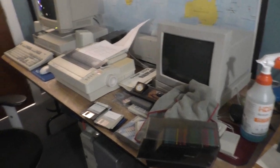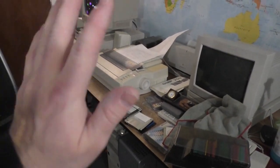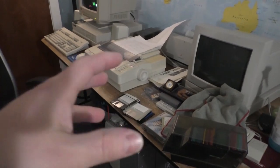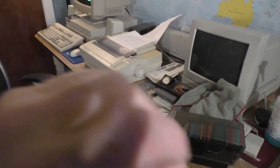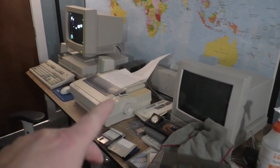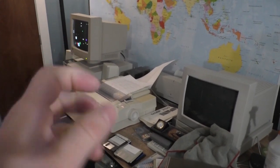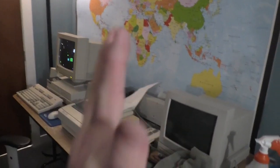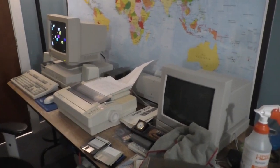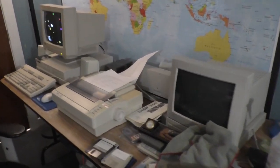Not IBM, but if you've ever used a daisy wheel typewriter, basically the typing elements are arranged in a spoke pattern, so all the characters and fonts, if you have to change the font, you pull the daisy wheel disc out, put another one in. They're arranged in a spoke pattern. It looks like a wagon wheel with a million spokes. And there's a solenoid that strikes whatever typing element is in front of it. So it's got a little servo that spins that wheel to whichever letter is being called for. So letter A, it spins to letter A. And then a solenoid strikes that letter A, hits a film ribbon, and it moves to the next character. A, B, C, D. And those printers were incredibly slow and incredibly loud.